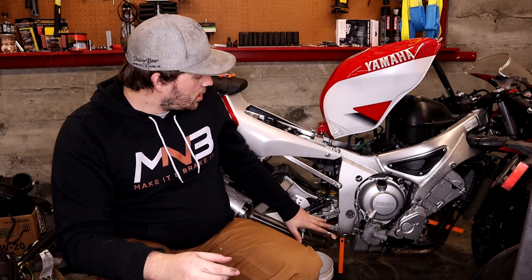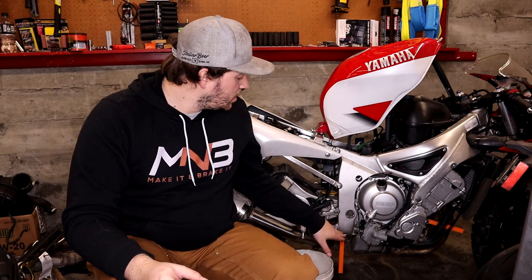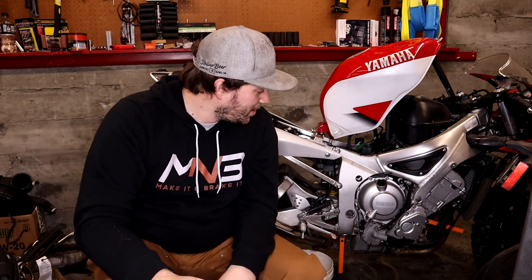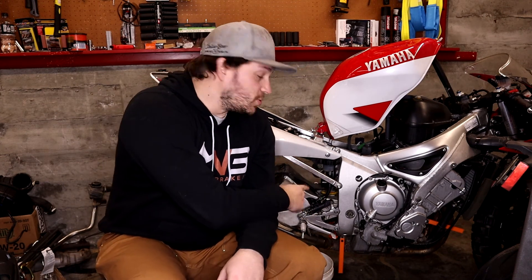We've managed to reconfigure our brake system so it'll actually work much better with our new rear set. We have our new spring working great — really good feel and good return even in this loose configuration. Our rear brake light turns on. We've actually upgraded and overhauled our brake system a little bit. A couple things we still need to do: immediately after doing any of these brake sensor installations, you do need to bleed the brakes. I'm not going to ride this immediately — I want to do a full brake system flush front to back. Don't forget to do that when you're doing this sort of work.